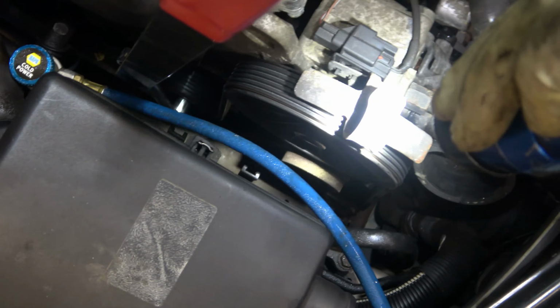All right, so once we have a little vacuum, I'm not going all the way to 30. I just don't want it to spray at me and have any oil come out when I open it up. So I've taken it down to about 15 pounds of negative pressure, and we are ready to take the compressor hoses off. Let's do it.